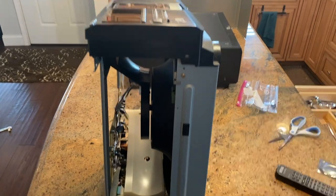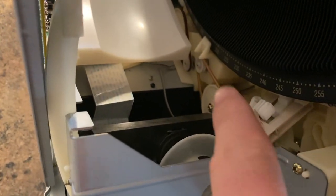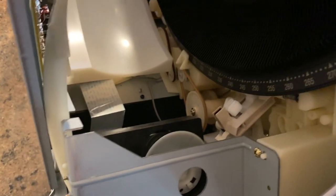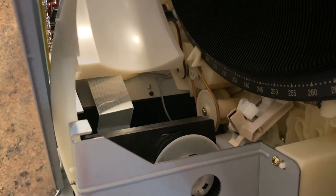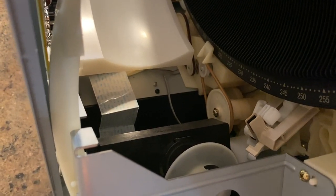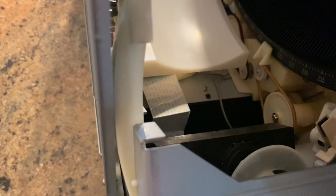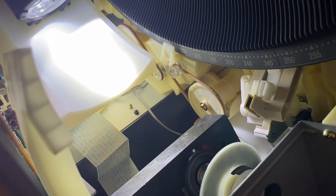On the CD 400, the way I'm doing this is standing the unit up vertically to allow gravity to work on those two rubber bands and make my life easier — I don't want to have to take the back off. This is not going to be super in-depth; I'm just showing in general what I'm doing. I'm going to work my hands in from both open ends and work those two bands off.